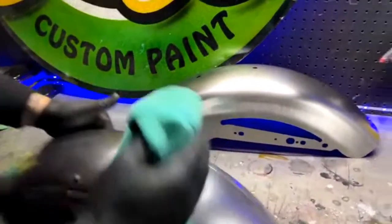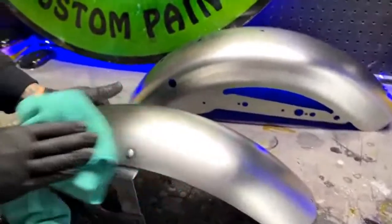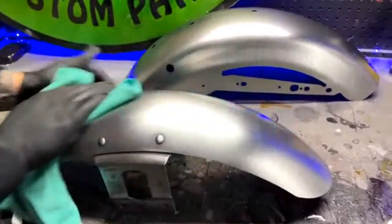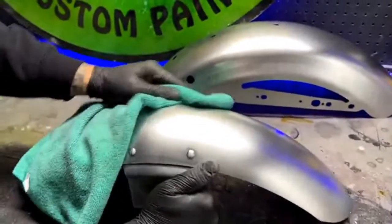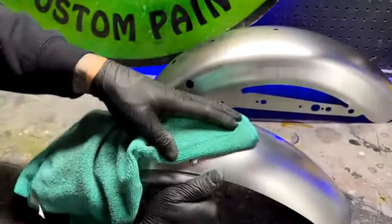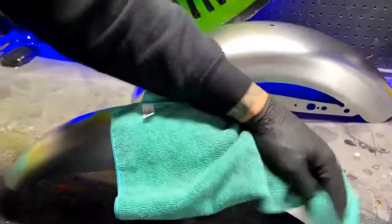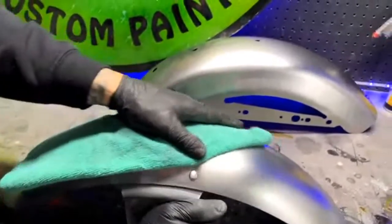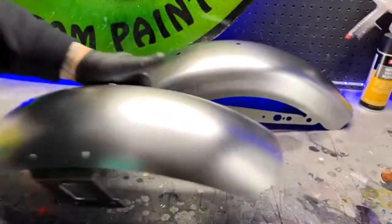Then someone asked, when you are sanding, do you go more than 600 grit? Yes, I do. If I'm trying to pull off paint, I'll use 80 grit or 180 grit. If I'm sanding Bondo, I'll do 80 grit or 180 grit. I'll even do 400 grit on clear coat sometimes. But I think 600 grit is the most widely used. At least that's what I usually use, and that's a lot of the stuff that we do sell. We find that to be the most useful.